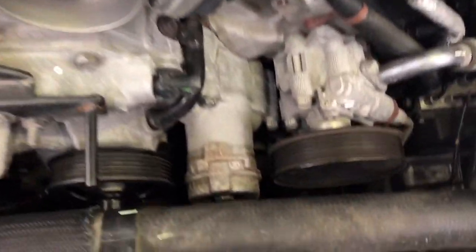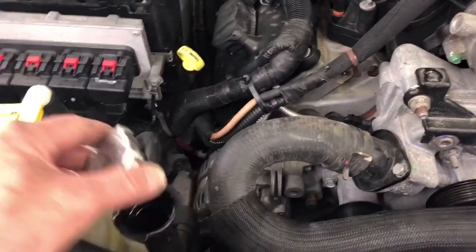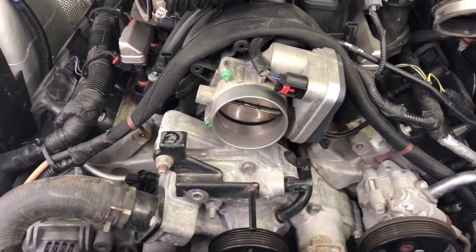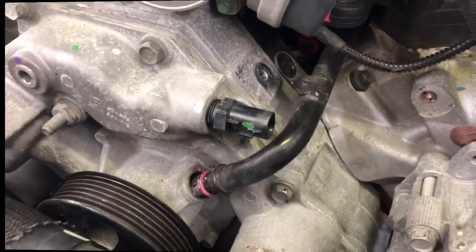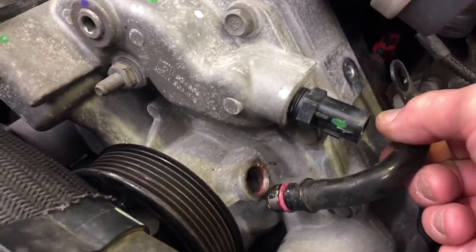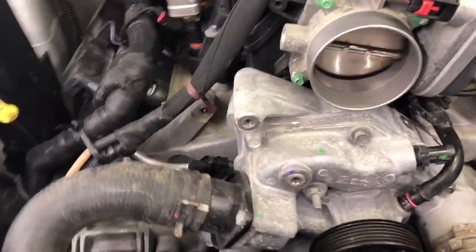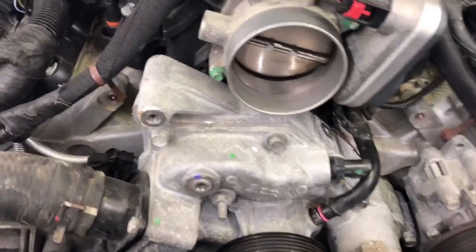First thing first, I've got a big drain pan underneath there. There's a petcock down there — got some coolant running out of it. I took the radiator cap off and loosened it up just so there's some air in there. We'll wait about an hour for it to drain all out before we start taking this off — I don't want to make a big mess in my garage. There's a little tube here sticking out — it's just a 10mm bolt that holds it in right there. Take the 10mm bolt out and that tube pops right out. The fluid is drained out; next I'm going to remove the top hose and the bottom radiator hose, then take the rest of the bolts out and it should come right out.